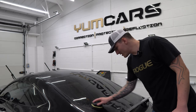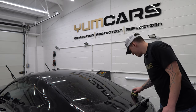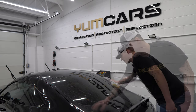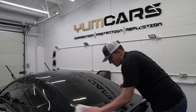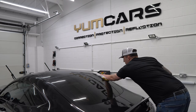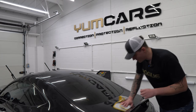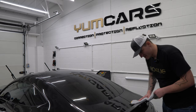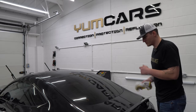I like to tell people: just make sure the car's wet and clean, close your eyes and feel it. I know this looks very creepy on your driveway, but the underside of your fingertips is one of the most sensitive parts on the body. Just feel it with your hands and dictate. If you've got serious contamination and you look like a weirdo — who cares? At least your car will be smooth. Don't worry — you're going to be IPA-ing the car after this anyway. You don't want anything inhibiting your pads because, trust me, with enough surface stuff being pulled off, the last thing you need is to be chasing your tail.